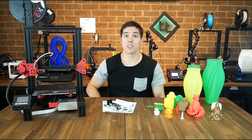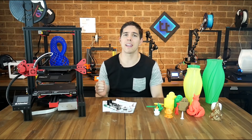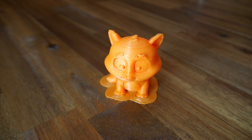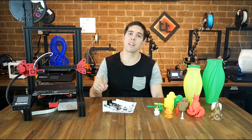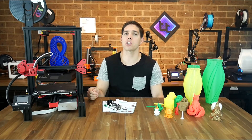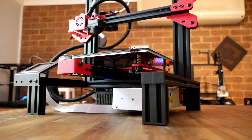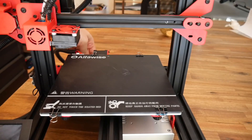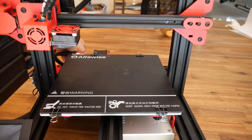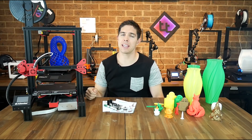On to the negatives. First and foremost, you can't ignore the poor print quality I had on this thing — gaps in extrusion, Z-banding, and part cooling that's not the best with that change of fan style. Safety is also an issue: this one actually caught on fire, and when I tested for thermal runaway protection, I found it recognized the problem but didn't bother to cut power to the hot end — so it'll tell you as it's burning your house down. There are also some weird design decisions: the micro SD card slot is at the back of the machine where you can't see it, making for very awkward usage. The ribbon cable is far too long, normally spewing out to the side and getting in the way any time you move the printer.